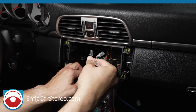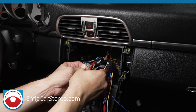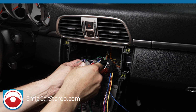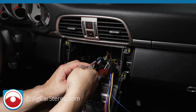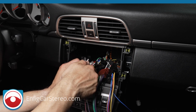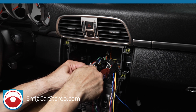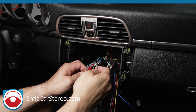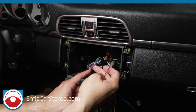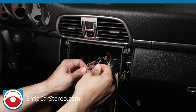Now this radio happens to have all the connections. So pink to pink is vehicle speed sense. If your radio does not have all the connections, do not connect wires that don't have the right color, because funny things can happen. If you connect pink to yellow with a black stripe on a Pioneer radio, everything works fine. But the minute you start moving, this vehicle speed sense kind of makes a ground and mutes your radio. It happens once a month.